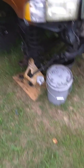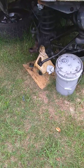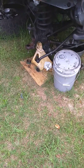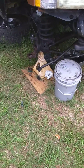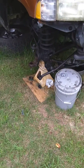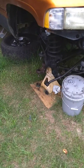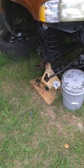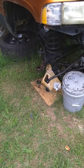Basically what you need to get is a '92 to '98 Dana 50 or a Dana 60, depending on which way you want to do it, front end. Not a Dana 44 8-lug — it's got to be a Dana 50 or the Dana 60. If you get the Dana 60 you could use everything from the knuckles out on that Dana and swap it all over. If you can get a good deal on them — around where I live they run as low as $700 but usually $900 to $1,000.